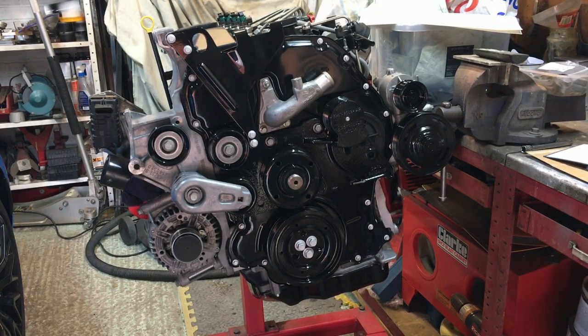I don't know what the make is, but it's got a semicircular symbol, almost like the old GWR steam trains had over the wheels, with no writing in it. I'm assuming it's Wabco, but it's definitely a high quality item. It's got moulded in O-rings, and they were in perfect condition. So, a tiny bit of Hylomar around the outside of the O-rings. Let's see if it leaks.